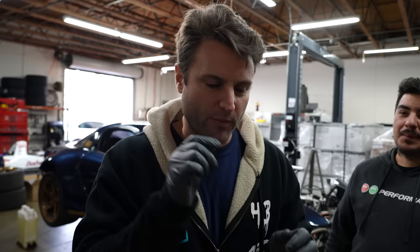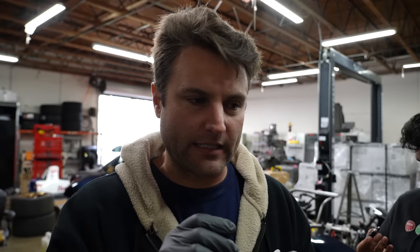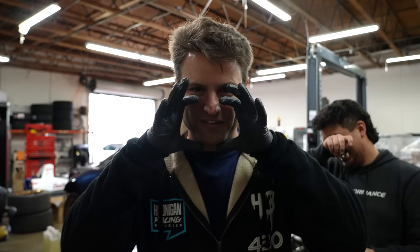Yeah, so the issue is, I pulled rotor 2's number one injector, so the first injector that's keeping it idling, and anytime you give it throttle response, that injector is the one responsible for it. It looked like I did, leaning over the toilet after I took two shots to every one shot of everybody else, with like this ring of froth around its mouth, and the other ones didn't. And so it's very traumatic for me to see that, and it is time to go get the injectors cleaned.